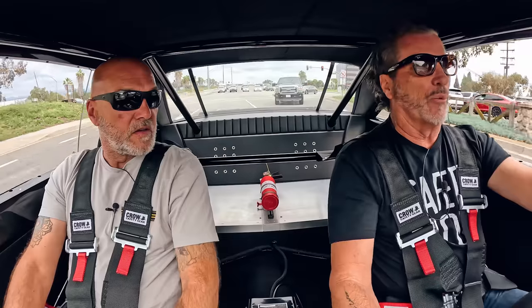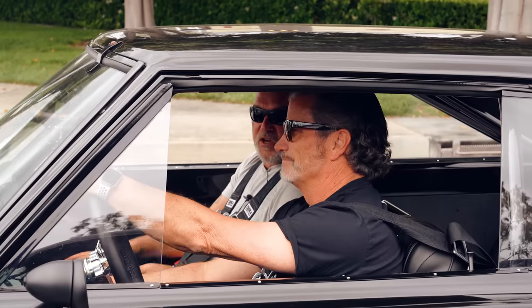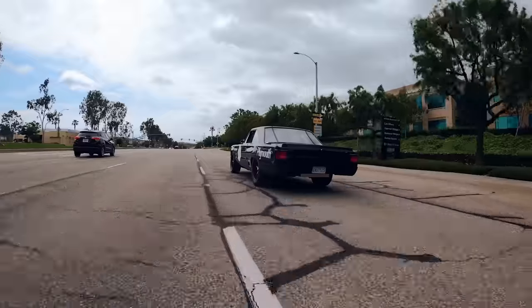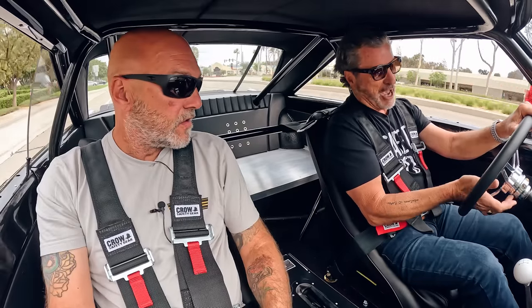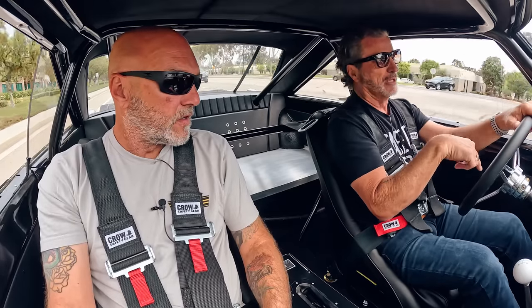This car sounds so healthy — throaty. One thing is the front steering has a lot of toe-in and camber right now, so the steering is really twitchy. I want to work through that with the owner. But from the passenger seat — I've driven old Mopars before that are all original numbers-matching — this doesn't feel like that on the road at all. You feel super planted. It's a tight build, almost like a watch. The one thing I don't like about these competition steering wheels is you get a little bit of jitter in the wheel.